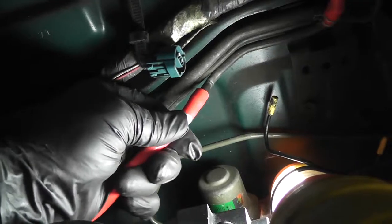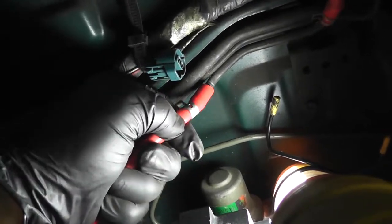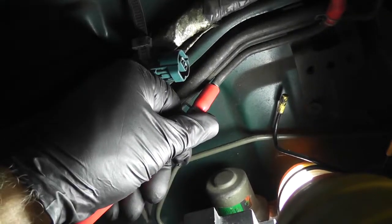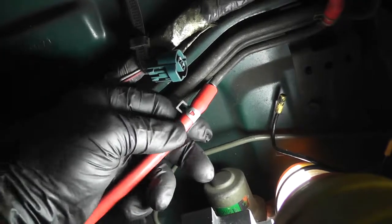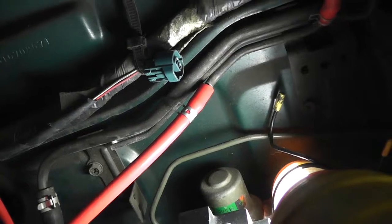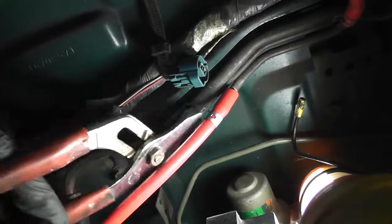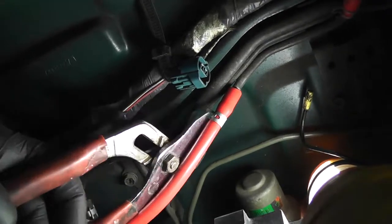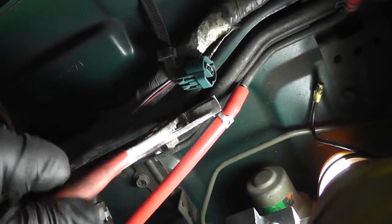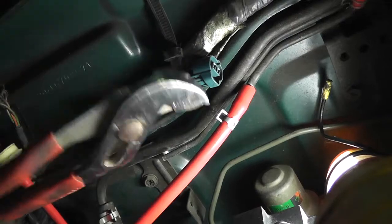That's the nice thing about these silicone hoses too, is they actually go on really easy. The original rubber hoses, a lot of them cracked when I was trying to take them off. The best thing seemed to be that if you twist them to break them loose, then you could wiggle them off. If you just tried to wiggle them off or pry them off, then they would snap or break. And my understanding is vacuum hoses are pretty tight normally, so you have to get a little bit of soapy water, put it on the tube, and then slide them on. So that would be kind of annoying. Thankfully, I'm not having to do that because these silicone hoses are really easy to work with, which I appreciate right now.